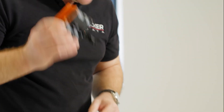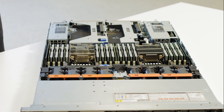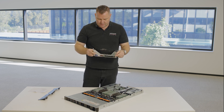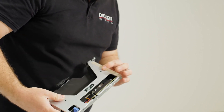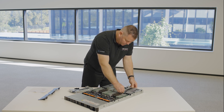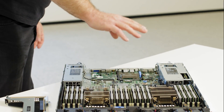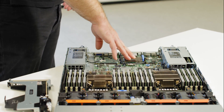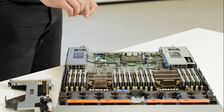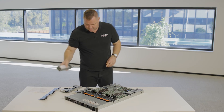Two little turbojet fans in each — easy to replace if they ever break, though I don't think they do that regularly. You've also got quick-release PCIe risers, which you can put your upgrade cards into as required. Two risers — PCIe riser one and four. Underneath we have the OCP3 network card, which is the same as in the 15th gen servers, so they've managed to keep the open networking platform going here. Hot-swap power, easy to remove if required.